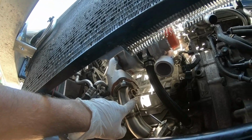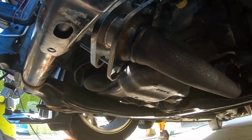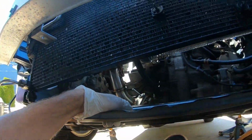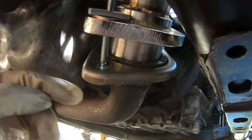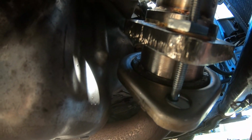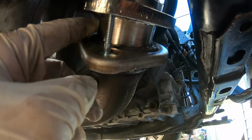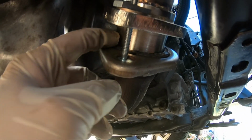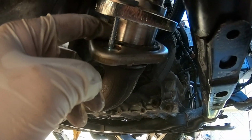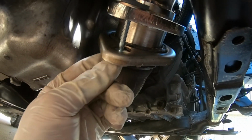Now, as far as the exhaust going down to the downpipe or the factory exhaust here, this might actually work. Let me show you guys what's going on. I'm reusing my factory donut gasket. As you can see right there, it's not the perfect fit, because the donut gasket's actually too small. We need a bigger donut gasket, a 2.5 inch donut gasket. But I think I bored out the donut gasket a little bit, so I'm thinking it might just snug in